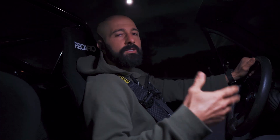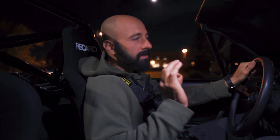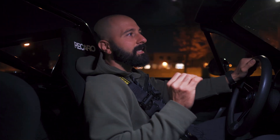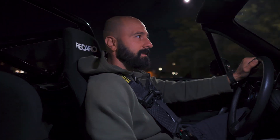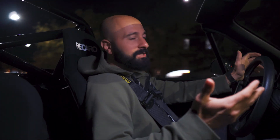Here's the thing: let's say you're developing a full-on race car, track only. You would actually put everything on the softest setting. You're trying to see what's the softest you can get away with, because soft means compliance, and compliance means grip, and grip is what gives you speed. And that's it for this video.